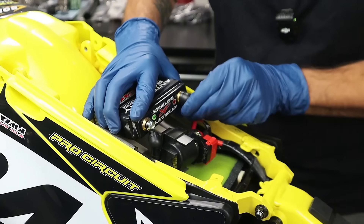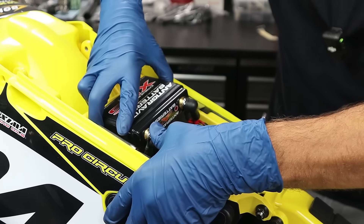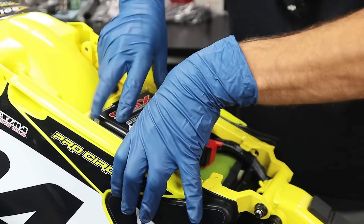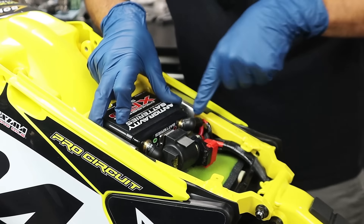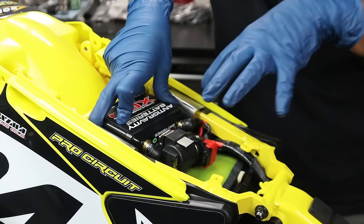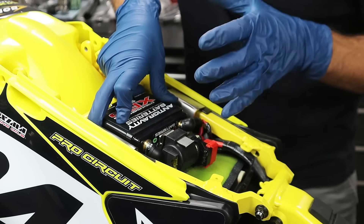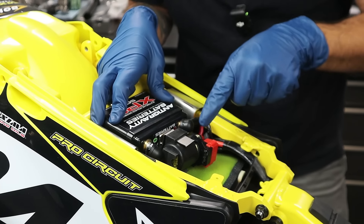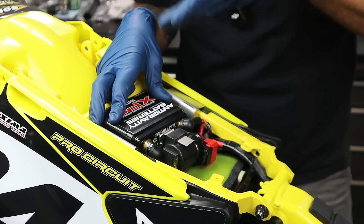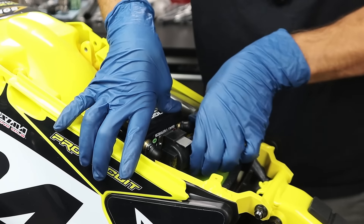Sneak those fancy dust covers back up and get both ring terminals on each side proper. Give everything a snug, solid cinch on both sides. Now as we push the battery back down into the tray, make sure especially on the positive side that the positive wire looping from your battery to the starter relay is not rubbing on the battery tray — because it's sharp enough that over time it will wear through the wire and you'll have a dead short with a nice big arc. If you need to, loosen the 10-millimeter nut on the relay and shape that wire the way you want it.